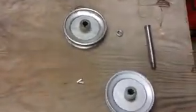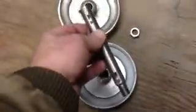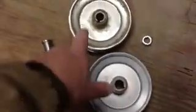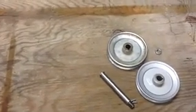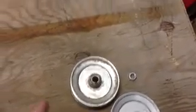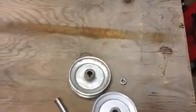Oh yes, one other thing. I've got my jack shaft apart. Throughout this whole build I've talked about the jack shaft using this quill assembly. I just want to show this with it apart so you'll understand. All this is this spindle piece right here with a keyway in it, and the keys are right there, and then the two identical size pulleys. The reason I do that is then I can get my gear ratio that I need by changing either the pulley on the transaxle or the pulley on the motor. If I need some finer adjustment, I could change one of these out. These are 4.5, so I could go to a 4 and get it right dialed in. But I usually like to leave these the same, so it behaves like it's not even there.